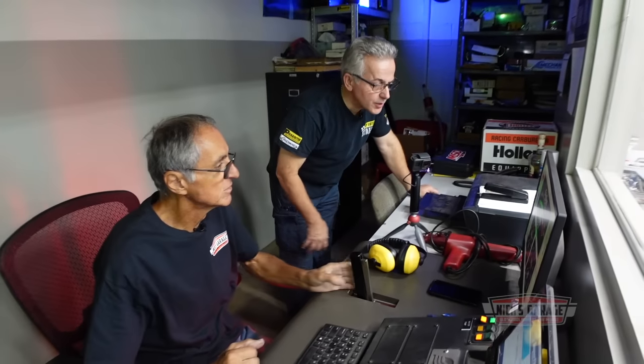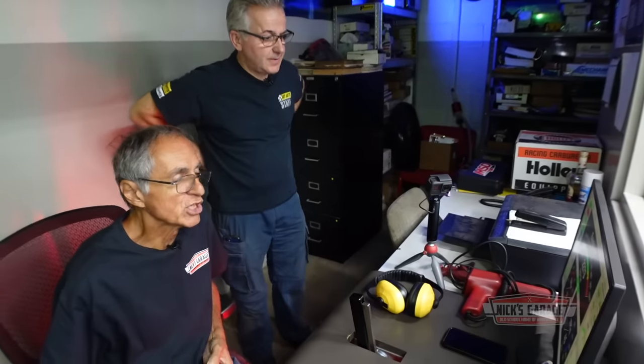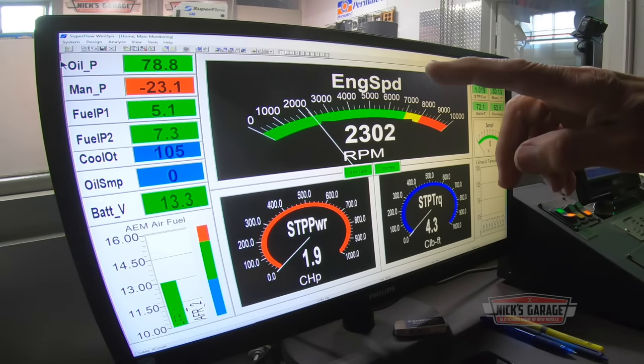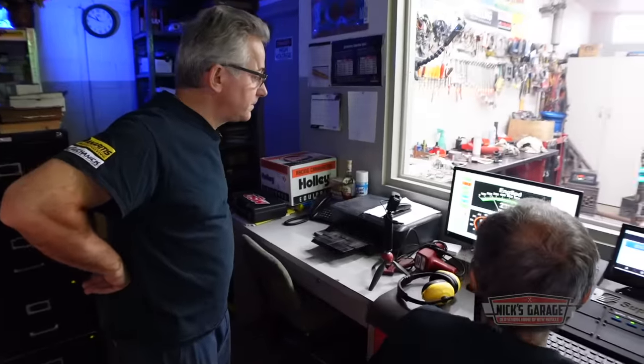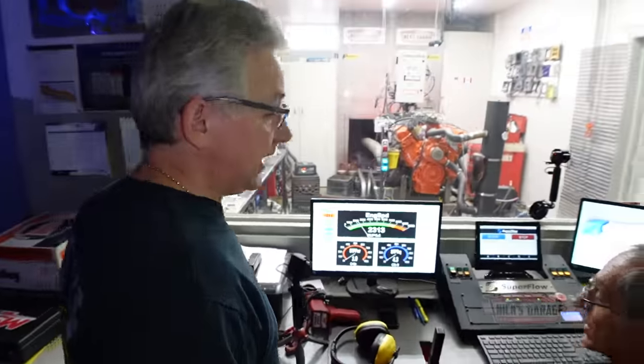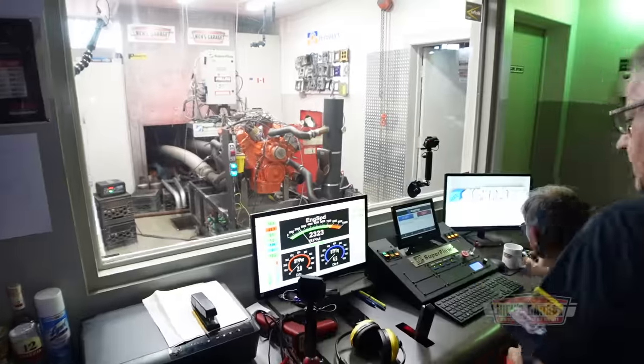Your air fuel is good. It's decent. The choke is tied open. RPM 2200, 2300. Oil pressure is good. Temperature's coming up. We got a very strong signal vacuum. Wow, that's good news, Nick. Let's see what it has on idle. I'm sure it'll be fine.